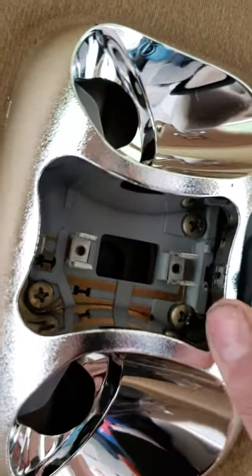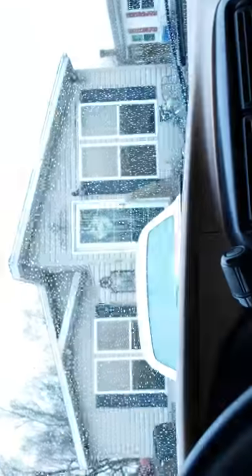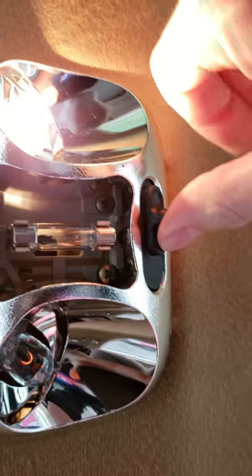Just like that, it's back in the truck with all three screws in. Make sure you do not cross-thread any of these — make sure they thread very easily because that little plastic clip will break. When installing the light bulbs, don't force them; they'll just pop in place. As for the map lights, they fit a little loose but they fit. The circular dome bulb is one-way only, so make sure it's facing up and down when it goes in.